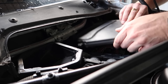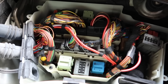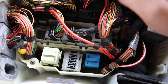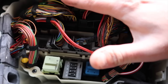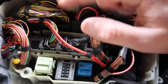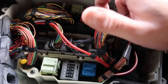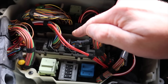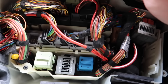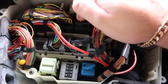Now they're all released. We're going to lift the cover off and take it out. As you'll see, we've now got a load of different ECU units in the main engine compartment. If you've opened this box on a normal E60, they're all here regardless of what engine it is — you'll have the ECU in here and also the transmission control unit. This one has the SMG control unit. The normal E60 doesn't because it's built into the gearbox with the mechatronics. This is where you'll find all your controls for everything.